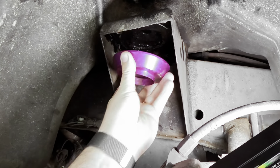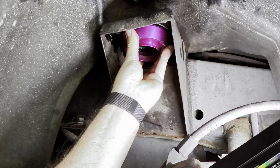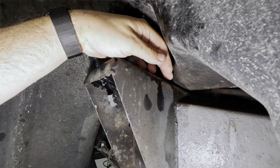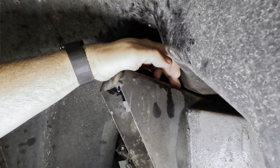Next, I have to drill some holes in the frame. I need to leave enough room for the spring collar, so the holes will have to be in the corners. This wasn't a problem for the outer holes, but the inner holes were basically impossible with the body still on the car. The body overlaps the frame and there's no way to get a bolt in there, even if I could drill it straight. Luckily, I don't need that many bolts — the only reason I'm bolting it in the first place is to keep it from rattling around. The shock stem will go through the center and the plate will be pinched by the bushings, with enough of what's left at the top of the shock tower to hold it in place and keep it aligned.